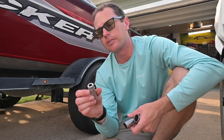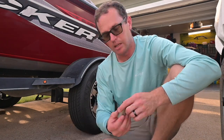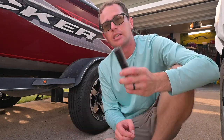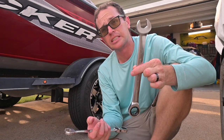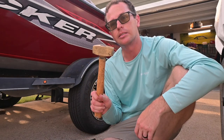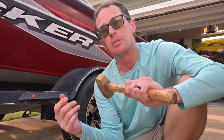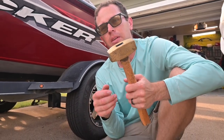These were about 90-something bucks for the pair. They are 25 and one-quarter inch eye-to-eye and rated to 1,800 pounds per spring, so for the set I'm good up to 3,600 pounds. I've already sprayed everything down with penetrant. Socket-wise, I've got a deep 3/8 drive with 5/8 socket, a 13/16, and a 7/8. To get the wheel off you'll need a 3/4 and 13/16, a 3/8 ratchet, a hammer — I'm using a brass hammer — and of course a floor jack and jack stands.